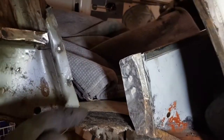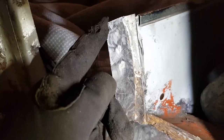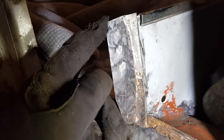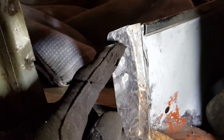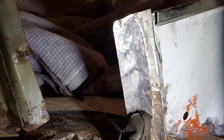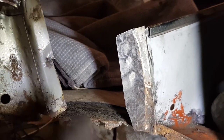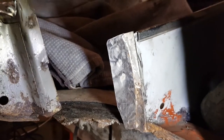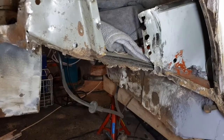I've got to a tricky bit - this is the skin of the wheel arch but it's also a double-skin section where the back joins the round bit, and it's spot welded onto the companion box. Flashing this back you can see one spot weld there, two, three, and possibly a fourth. I'm going to try drilling those out, which means I'll have holes in the companion box, but I'll need those anyway for when I plug weld the wheel arch on.